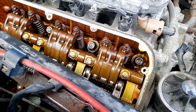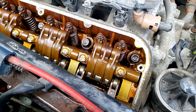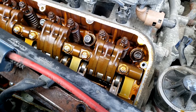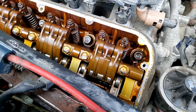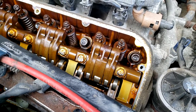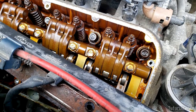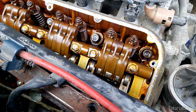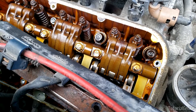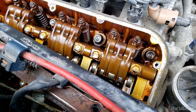All these things are considered when the ECU decides it's time to switch up into VTEC. And when switching back down out of VTEC, that occurs at a lower engine speed than the switch-up point — just to avoid a situation where you're at a certain RPM and it's constantly switching in and out of VTEC.